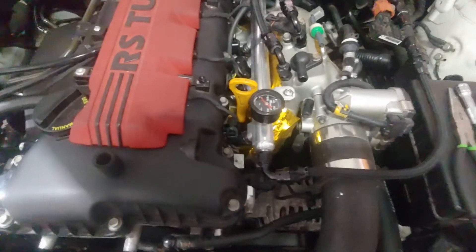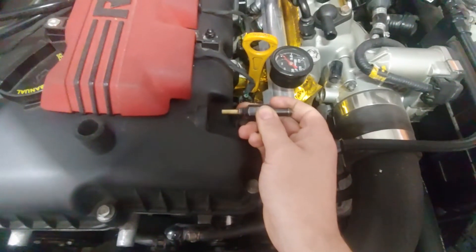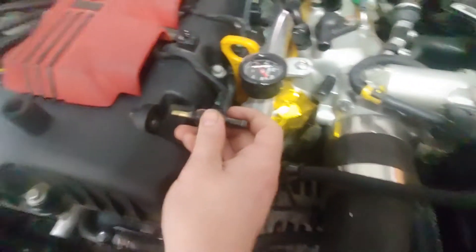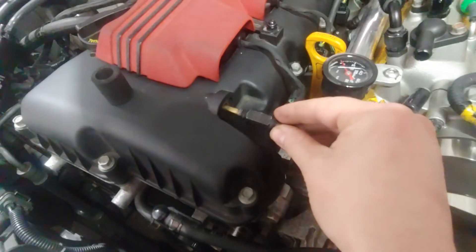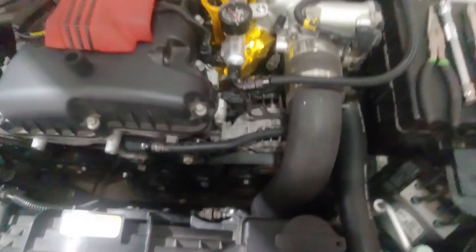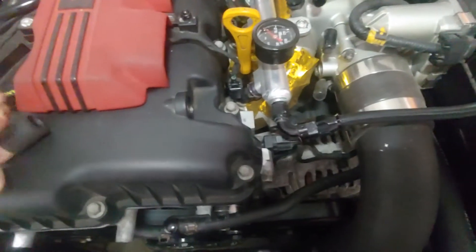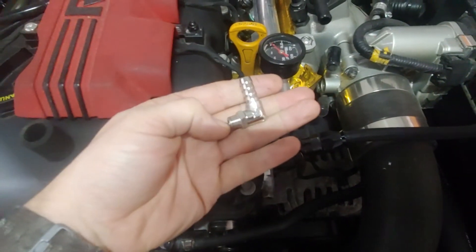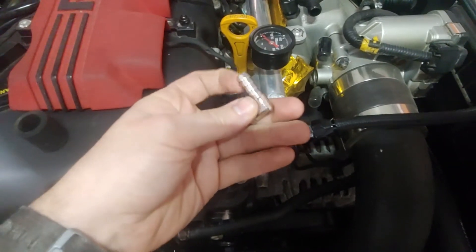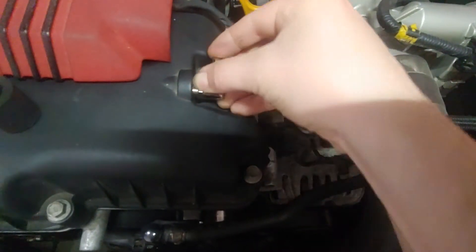I've removed my PCV. If you want to reproduce what I'm doing, this is a 1/8-inch BSP thread — it's a tapered thread but it is different than NPT. If you try and run an NPT in here it'll work the first time but then it'll gall up the threads or strip them and they won't seal anymore. I found a place online that does a 1/8-inch BSP to 3/8-inch barb, and I'll put this swivel fitting in here.